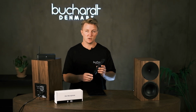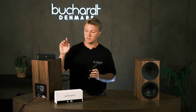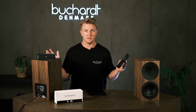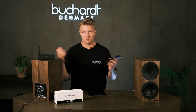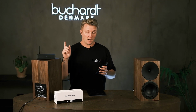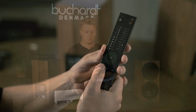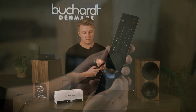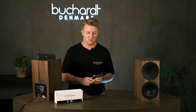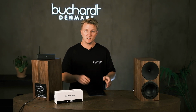Oh, and another function of the remote is to make Bluetooth either invisible or visible. Now, as stock, the Bluetooth will be visible, but that means that anybody near you can actually log into the Platin Hub, and it will jump over to Bluetooth channel, and they can turn the volume up, and that will be quite annoying. So if you are living in a place, maybe in an apartment, where you have a lot of other people around you, I recommend strongly that you disable the Bluetooth visibility, and you do that by pressing and holding the track back for 5 seconds. You'll see that it will just give a short flash indicating that now it's invisible. And if you want to make it visible again, you just press the track forward button for 5 seconds. But it can also be done within the app.